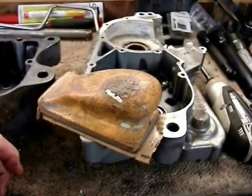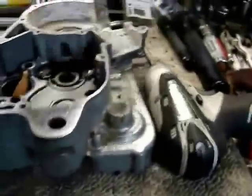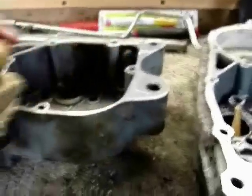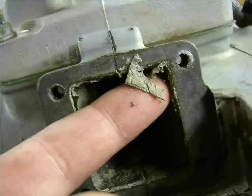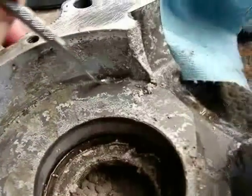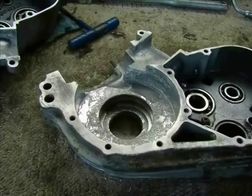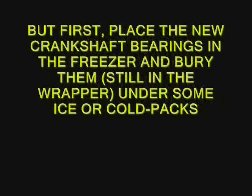After I get the gasket material cleaned off the center cases, I use a flat sanding block with 180-grit paper — just scuff it up, make sure the surfaces are perfectly clean. Take out all the remaining seals. Because this was a massive goo, I really scrub these engine cases, starting with dental tools, then a new fine stainless steel brush with lava hand soap and hot water, scrubbing the mud out of every little crevice and the transfer port passageways.